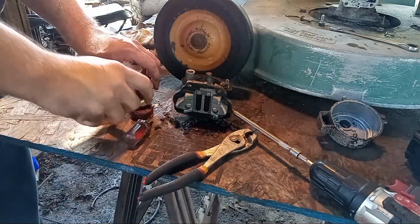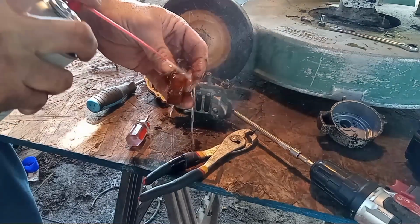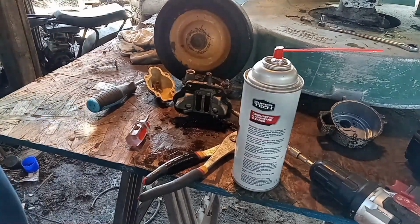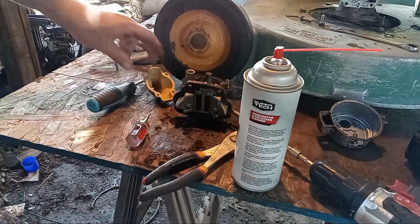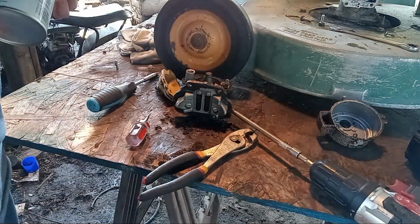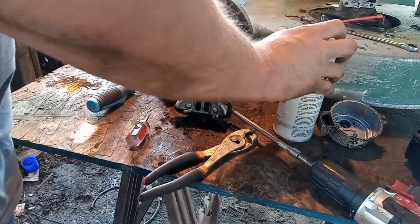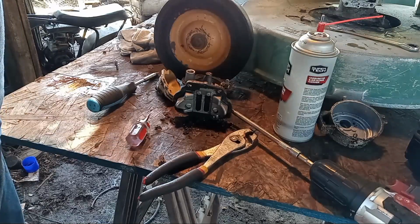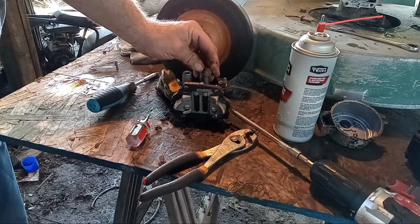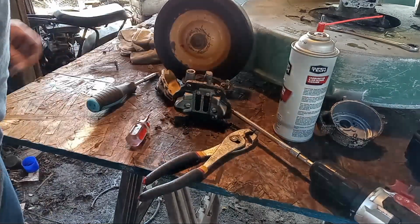All right. Oh yeah, I need to blow the float off too. Make sure that's cleaned out. I would say we check it, but it's a cork float, and it's going to float, because they do, because they're made out of cork. Unless it's falling apart, coming off in chunks, it's going to be a good one. Okay, screen cleaned up nice. That goes back over your, okay.